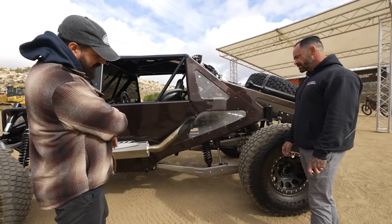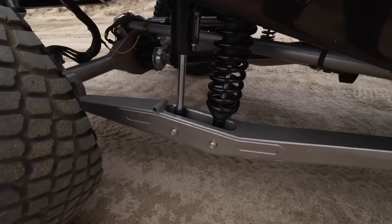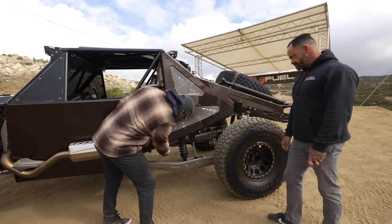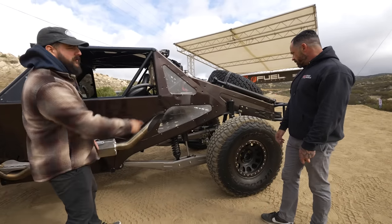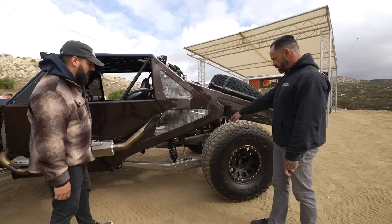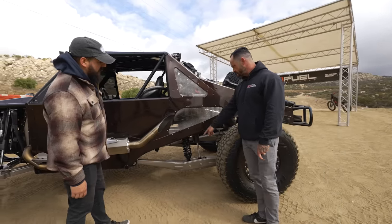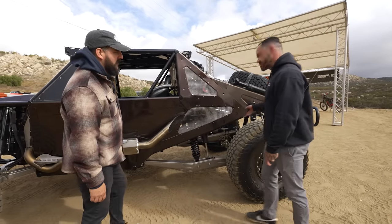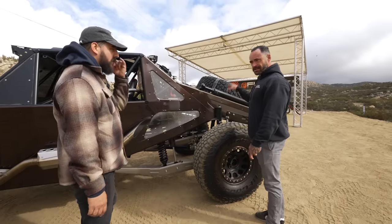And then I'm noticing this big old giant freaking arm here. Yep, trailing arm. This is a trailing arm, right? Yep. Is there a benefit to connecting it here or further forward, what's that deal? There's some pretty traditional stuff these days and it's a motion ratio thing. If you have a shock of this length and you put it halfway in here, then your travel is exponentially greater back there, at the source where it's working.